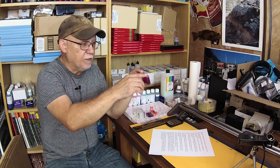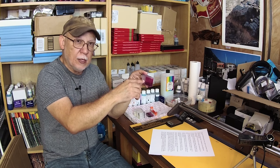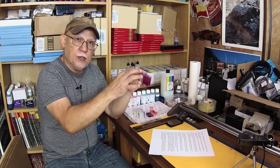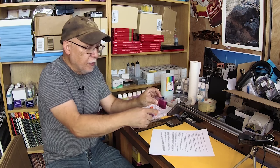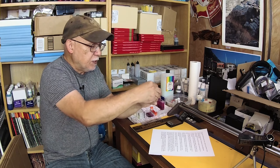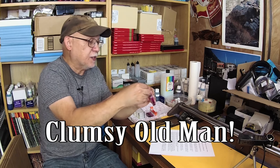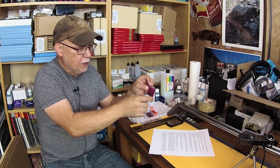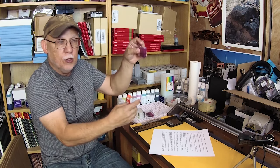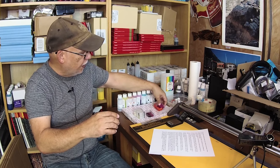When you plug it in, leave the vent open — don't tape that down yet. This will equalize both chambers, and then you can top off if you need to. If the liquid chamber has dropped considerably, meaning the sponge has absorbed as much ink as it can, go ahead and top it off and plug it. Then you test ink flow by holding it over a paper cup, removing the plug — you should get a continuous drip. With the chamber plugged in and the bottom uncovered without a clip, you should not get any dripping. That's what you're shooting for. All of this is on my videos — go to my CLI-42 section.